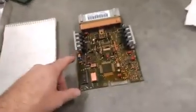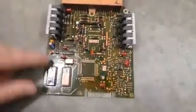The capacitors you need to order — they don't really make the original ones anymore, but here are the part numbers. Two of the three are the same: 16-volt, 47-microfarad. The third one is different at 63-volt, 10-microfarad. You may not get the exact same capacitors, so ask an electronics guru to get you as close to those specs as possible. All of these are rated at 105 degrees Celsius, so you need that rating or higher.